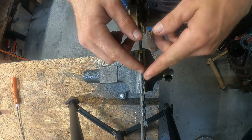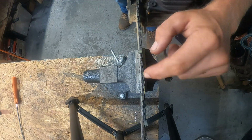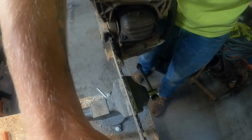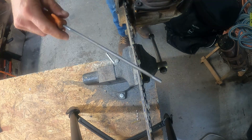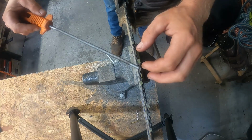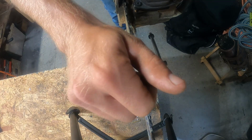As this tooth goes into the wood, the point pierces the wood, and then this top plate creates a slicing motion as it goes through, and the hook grabs the piece like this, slices, and then the hook grabs and peels it out. So they all work together. You know what I mean? So it's important that that top plate is sharp. And the reason you want to get that gullet out, that lower material, is because as it slices through, the more space there is in there, the bigger of a chunk it can pull out. That's room for the material to go. As it slices through, it pulls that wood down into there and gives it a place to go. As it cuts through, it hooks it and it slices and peels it down in.